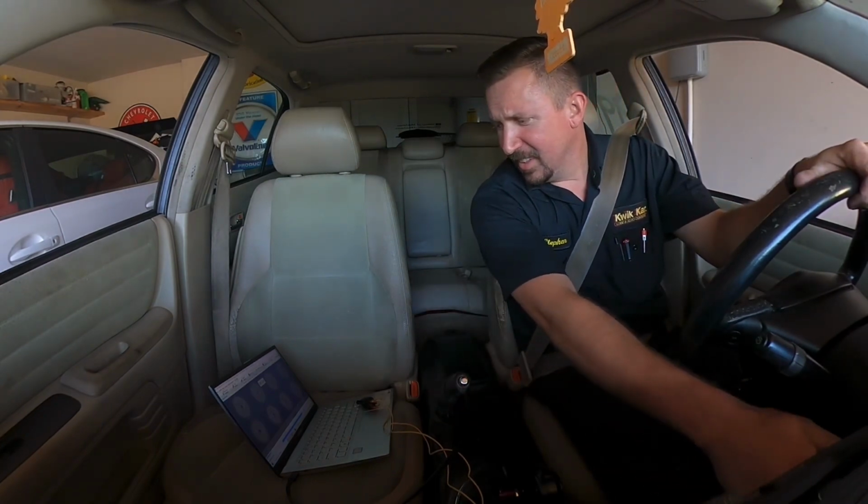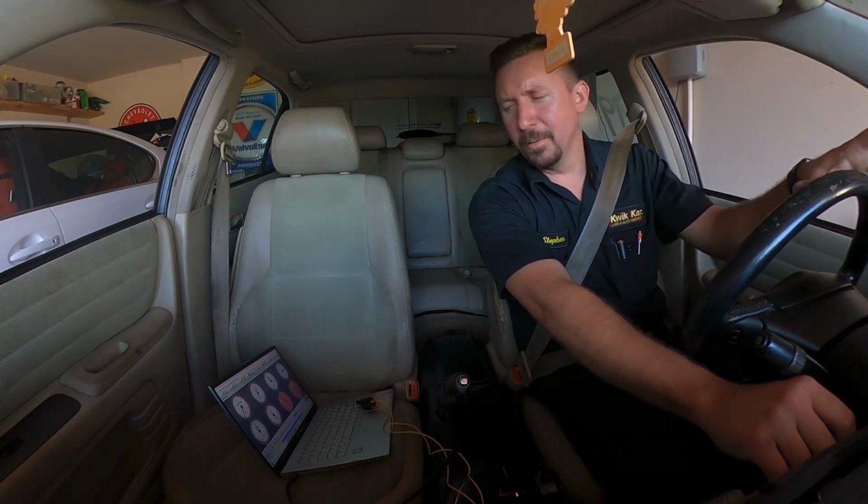All right. So I took a little bit more fuel out of it. It was floating around like 10.3. And you don't want to go too rich with nitrous. I'm told that can be just as bad as going too lean, or nearly as bad. I'm not sure if there's any legitimacy to any of that. But anyway, you don't want to run super rich anyway, so I cut a little bit of fuel out, not much. It'll still be on the rich side.